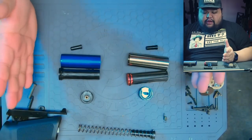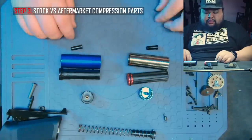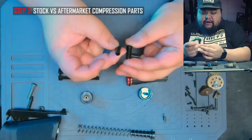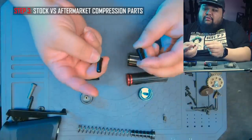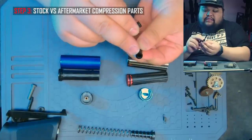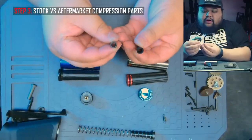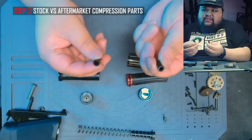We have all of the compression sets on the table — this is the OEM set, this is the aftermarket set. Let's compare them quickly. This is the Apex original air nozzle versus the Modify o-ring air nozzle. There are some external shape differences — this one has a little rim right there which doesn't really matter. The main difference is on the inside of the air nozzle where there is an o-ring to rub against the cylinder head to keep air from leaking out. That is one of the biggest places where air leaks out, and having the aftermarket versus OEM there is a world of difference.